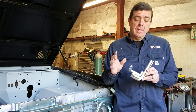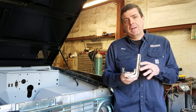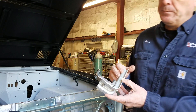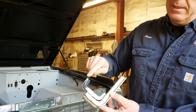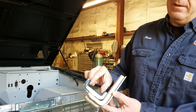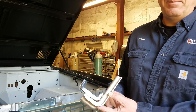I went ahead and mounted the lower support to the bracket so I could get it screwed to the radiator support and make sure my fit's right before I weld it in. I did have to make a little bit of adjustment on the bracket. Right in here I had to taper the edges out because the radiator itself is a little bit wider — there's some welds there. That little taper helps it fit.